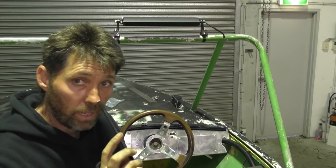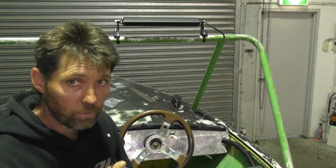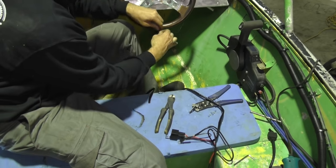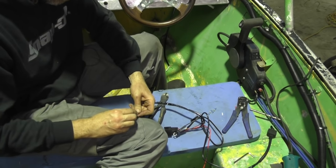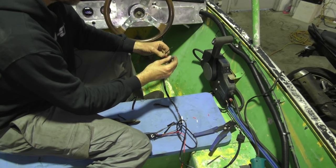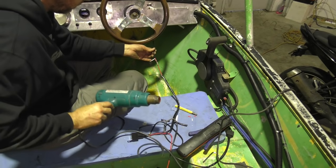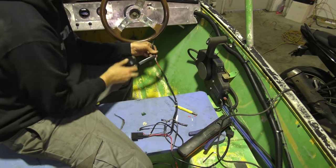It's hooked through on the other end, so I can feed this in and get my soldered joint inside the railing. I'm going to seal this up and protect the wire from chafing on the sharp metal edge with a bit of Sikaflex. Now I'm going to solder up the end that's come through under the dash — I'll attach the positive to pin 87 on the relay, which goes active at 12 volts when the relay is activated by the switch, and the other wire goes to ground. I'll separate these wires and do the same with the two leads from the original loom going to the relay, using a couple of these low temperature solder heat shrink combination connectors since it's easier when I'm in the boat. I'll then put a bit of electrical tape over those heat shrink connectors for a little extra protection.